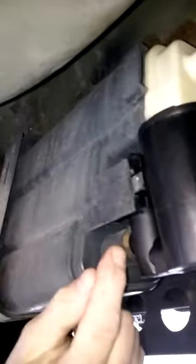This is clipped in place — I heard it snap, you can see there's a little snap right there. So what you do is you get it out: take a screwdriver and pull this back. The first thing I would do is pull these clips, get this off, because by holding this in place the tube comes out pretty easy. Then you unhook the connector. Next, take your screwdriver, pull this back, wiggle it and it comes free. Then you remove the grommet, put the grommet on the new one, and installation is the reverse of removal. That's how it all works.